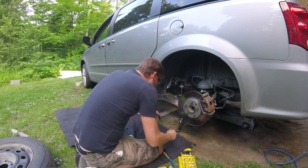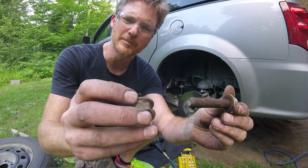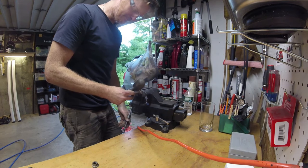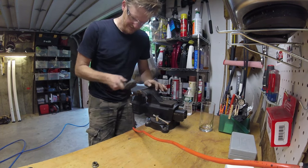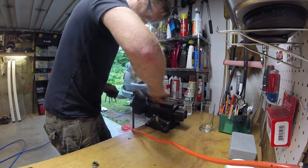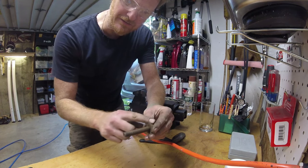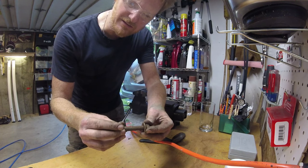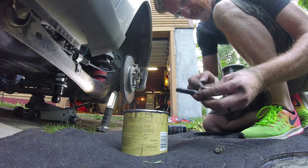Just started a little bit, now I've got to do the other one. This is the lower bolt — check that out. It needs wire wheel cleanup. We'll do that before we put it back in. That's nasty. The other bolt was clean, so it's isolated. This one's dirty all the way across, so I'm going to grease up the whole length of it just to keep the corrosion at bay. Lube is your friend.